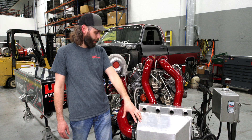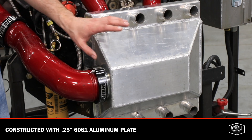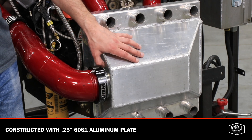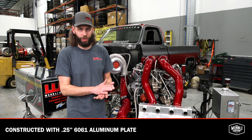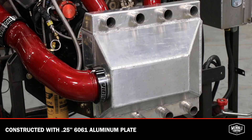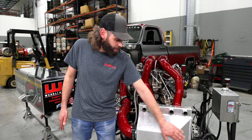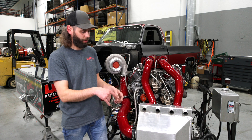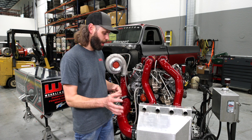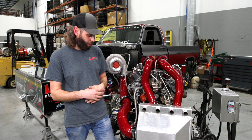It's a little overbuilt for the three-inch class, but we build it prepared for anyone wanting to bolt on a 3.6 turbo. We fabricate all of our air-to-water intercoolers with quarter-inch 6061 aluminum plate. Both the hot-side and cold-side end tanks are quarter-inch thick. We use 6061 because it's a much stronger temper than 3000-series or 5000-series aluminum, which is softer and has a much higher chance of expansion issues on larger, flatter surfaces. We fabricate both end tanks and weld all the inside seams before welding to the core halves, so they're fully welded inside and out to withstand higher boost pressures and give you a longer-lasting intercooler.